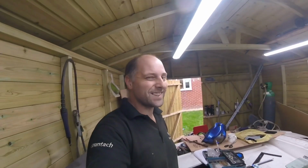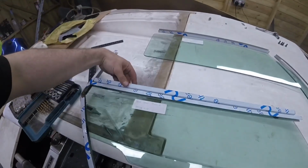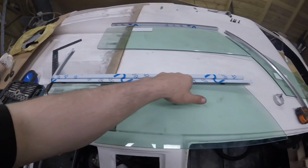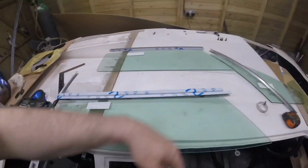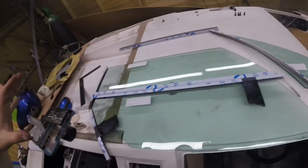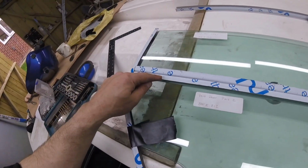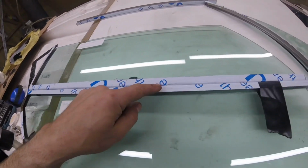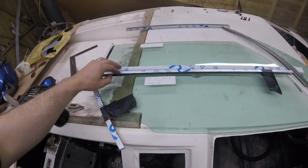Yeah, it's a pretty face of mine, a lot of thinking going on up in here. So that's what we'll do. We'll drill some holes through there, and then we'll get the TIG in there and we'll tack them together. Done. I've mocked up how it's going to be, and I've got little lines all the way down to match it up. Just going to take them back apart, weld these paired together, and see what comes out.